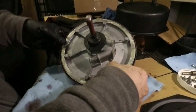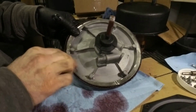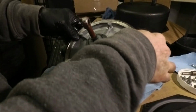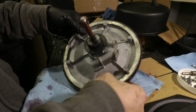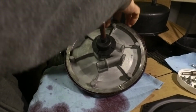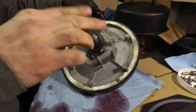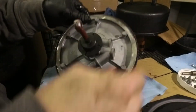I read them over in the shop manual. The Moraine one. This is the Bendix one. It's more of an assist. It has a neat little mechanism, though. If you slam on the brakes, apparently it lets the ratio work the way you push with the pedal instead of just prematurely overcoming your pressure with the vacuum and locking up the brakes.